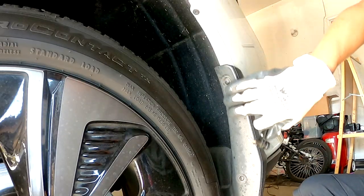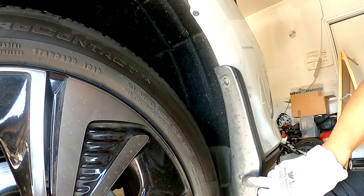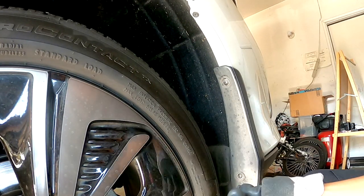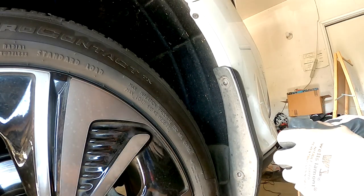On the rear side of the wheel well there are going to be three Phillips head screws. It helps to have a tool just like this for the low clearance here especially. You can tell somebody stripped this screw a little bit, probably installing mud guards, but this tool will help you in this area — you won't have to get it at an awkward angle. It fits in that space and gives you enough leverage with the handle.